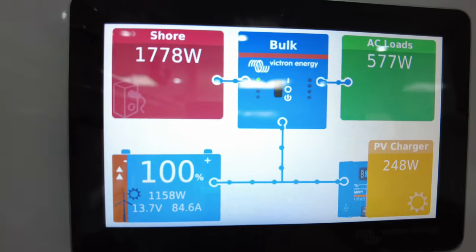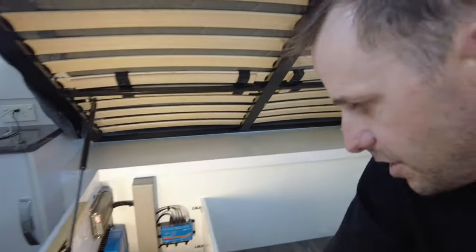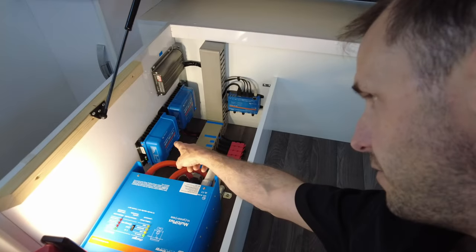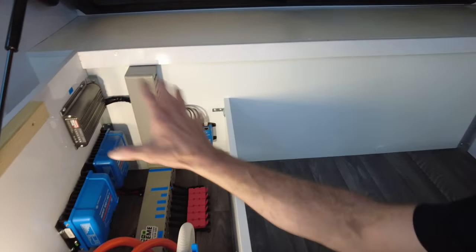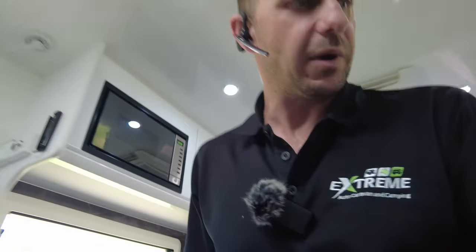Battery's pretty close to full. We're synchronising at the moment — the batteries are probably slightly down from 100%. Pretty cool, it's a good little feature. I'm glad Victron have done it. It is a setting that needs to be programmed from the start, and we've done it. ANL fuses, MultiPlus inverter charger, there's the 50, there's the 30 amp, there's your Redarc 25 amp DC charger, there's the Cerbo GX — batteries other side of the wall, all vented around the front, side and back of the controllers. Thanks guys for watching. It's only a quick one on this one — another busy week. Like and subscribe. Take it easy.